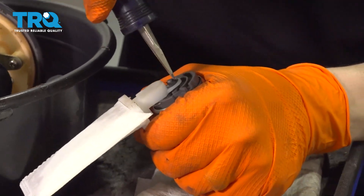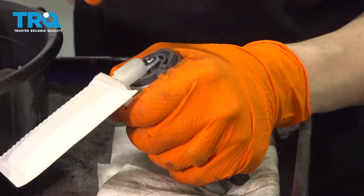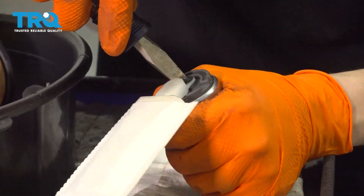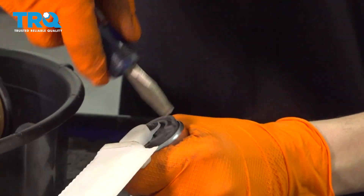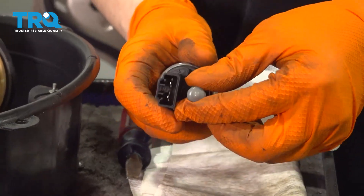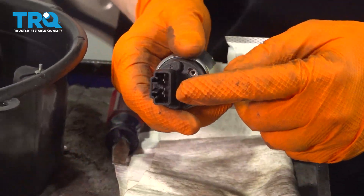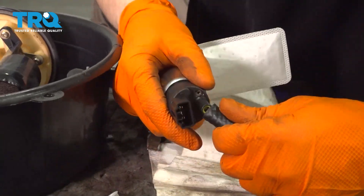There's a little locking retainer that comes with the kit — press it down to lock the filter in. It's a bit difficult; use a screwdriver to press it down and make sure it's bottomed out completely. The little spiky tabs grab onto the plastic pin and lock it on so it doesn't fall off inside the fuel tank. Flip it over — this end is capped off too, so remove that cap and slide the fuel hose on.